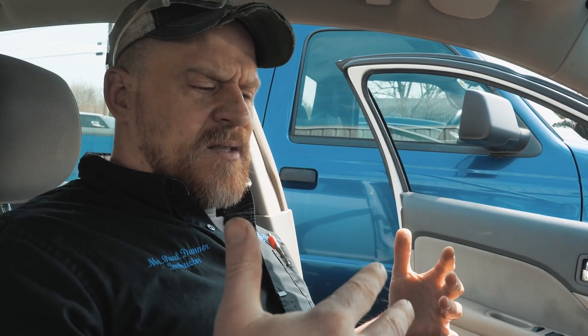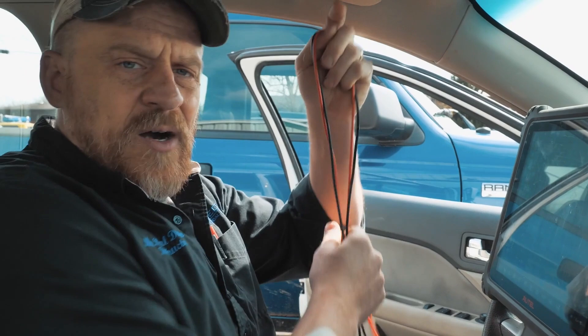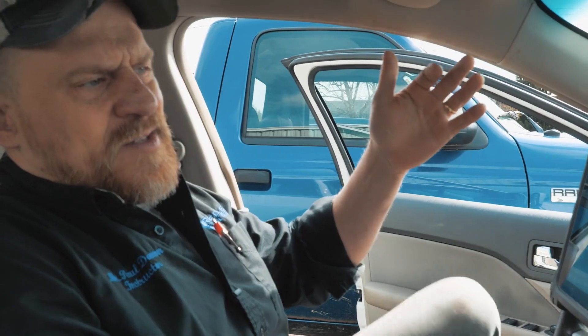What I want to do is essentially that, but I found a connector on the diagram that will separate halves of the system. Then I can figure out where I'm at, eliminate stuff under the hood or inside the car, and that'll save us time locating what I believe is a copper-to-copper short within a connector. We're going to find water or something in a connector causing a trace voltage across pins. There is no easy way to locate that — there are varying ways we can attack it, but there isn't any silver bullet test.